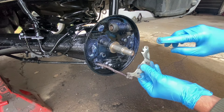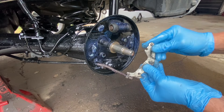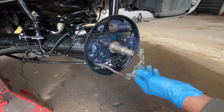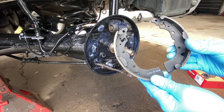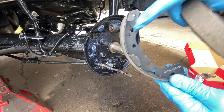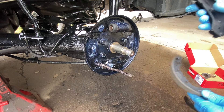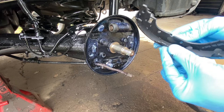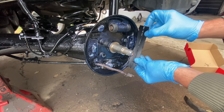Just a little bit there too. Okay, now we're moving on. Now we're gonna install the new brake shoes — this is the direction they go in. See with these rectangle holes going up, and you'll notice on the back here there's like a hook, so that goes in behind here like this.